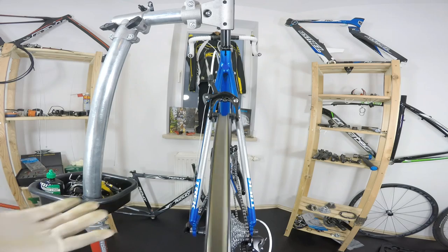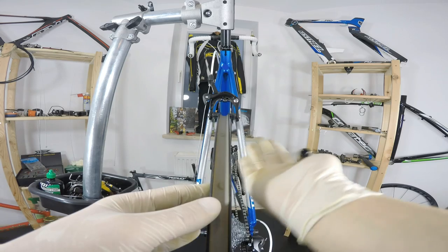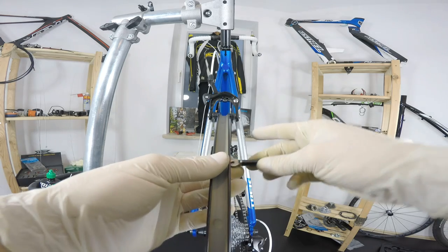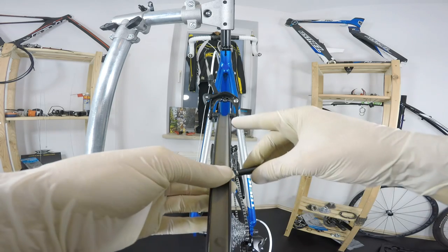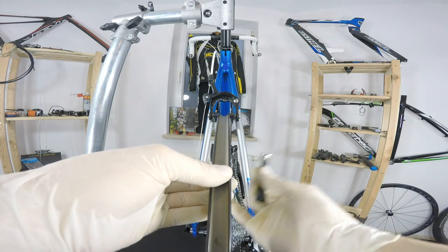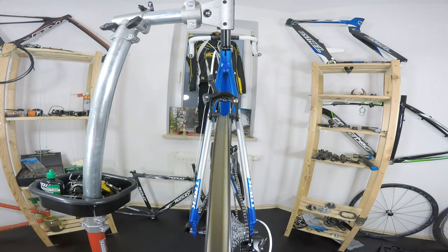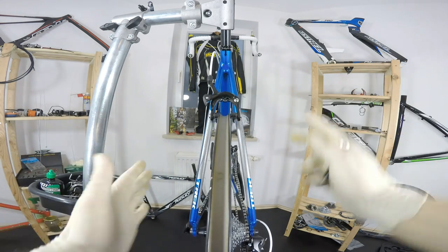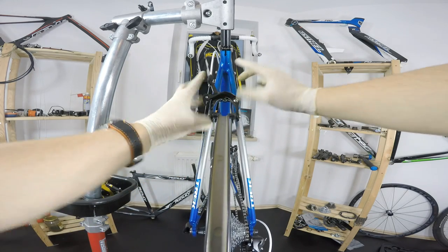All right, this actually helped. Once more, what I did was to release some tension on the right side and put some tension on the left side. If you're looking from the top, I would do like 1/10 or 1/12 of a turn counterclockwise on the right side and clockwise for the spokes on the left side. I already saw that even the caliper was set for the wrong dish of the wheel. I've just fixed that. Yeah, so it's centered now.